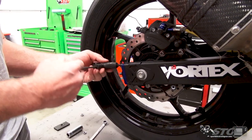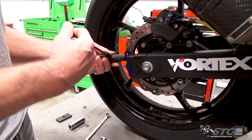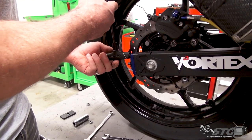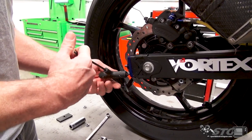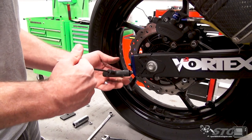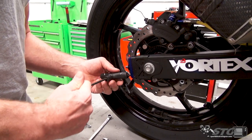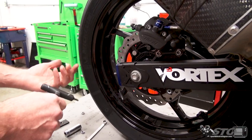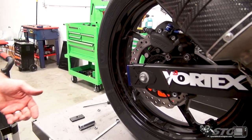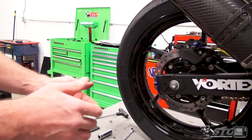I had a great question on the R3 install video: do I think there's a need for any anti-seize or thread locker on these fasteners with the ramps? I don't think so. I'll double-check this obviously when I do my routine maintenance. For us, I'm checking chain slack constantly before every race or track weekend. The first few times, I'll throw an Allen wrench on there to see if they're loose. If I have any issues, we'll circle back and use some thread locker. My expectation is there's enough friction generated from the ramps on the cams to hold the fasteners in place.